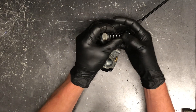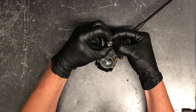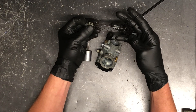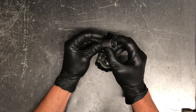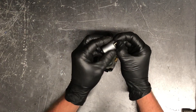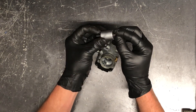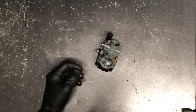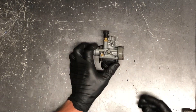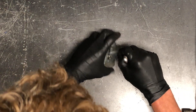Now we've got that out — release that spring, release the cable, and set that aside. If you are wanting to replace that cable, you just take it out of that bushing, it will slide up out of that spring and out of this cap — you just have to unscrew it. Now this needle on the slide is adjustable. I believe there are four or five different settings; right now it's on the second groove from the top, but you can adjust that depending on what's done to the motorcycle. Next I'm going to pull this choke assembly off.